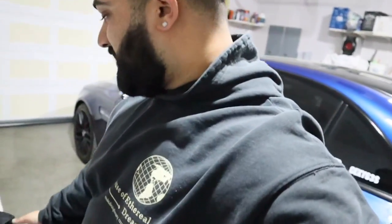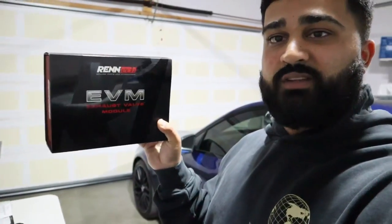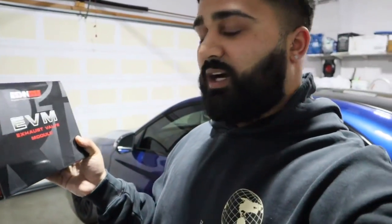We're back. I got a pretty cool mod — it's been something I've been looking at for a while, just trying to find the best price on it. It is the Rentec EVM module — exhaust valve control module. Just an easy plug-and-play thing, not really much of a mod, but it's a kind of tweak into the exhaust system of the car. Basically what this does is it keeps the valves open 100% at your own discretion at a click of a button, instead of relying on a system that's capped off at a certain RPM — 4,000 RPM — and a certain speed, I think around 65 miles per hour.